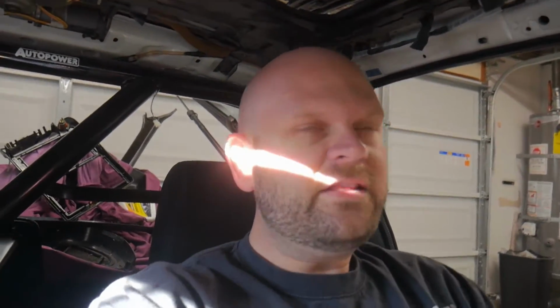And when I cleaned the engine bay, just sprayed it out with soap and water prior to going to 7 stock, we got a weird fuel pressure error. It was saying like 1500 psi or something crazy. We refilled the fuel tank, cleaned the fuel filter, and double checked all the fittings, and it went away in the morning. I didn't think those two things might be connected. In fact, I thought maybe the fuel pressure sensor was the problem.